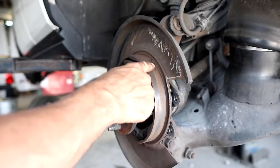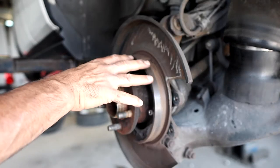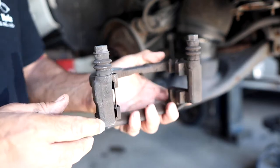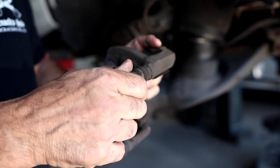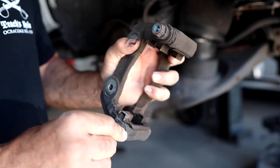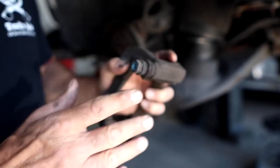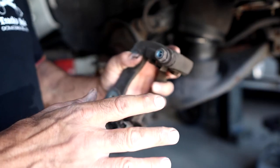And there you go — these are your emergency brakes. Make sure before you go back with anything, take brake clean and clean off the emergency brakes and clean the surface all the way. One thing you want to make sure when you remove the caliper bracket: always check the slides. Make sure they slide in and out nice and easy. If they're sticking and hard, you need to take the pins out, clean them, re-grease them, put them back, or replace them with a new hardware kit. If they're not working correctly, they will cause your brakes to wear out unevenly.